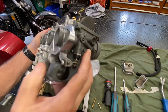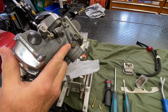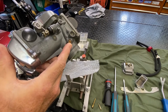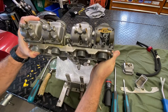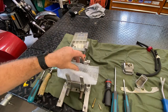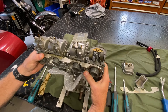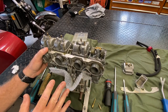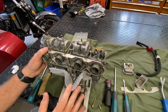As far as the air screw goes, I generally start with about half a turn and then work my way either in or out. I've had them where a quarter turn runs perfect depending on the jetting and setup. But you've got to know where you're starting from — that's probably the most important lesson in this entire video. You cannot take anything for granted on these. You have to know your baseline.